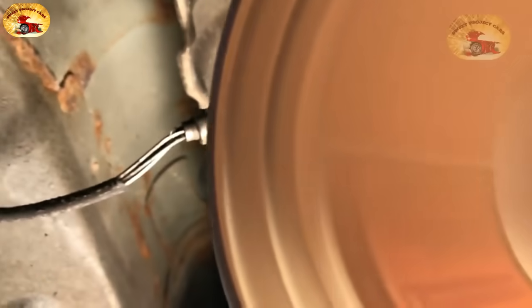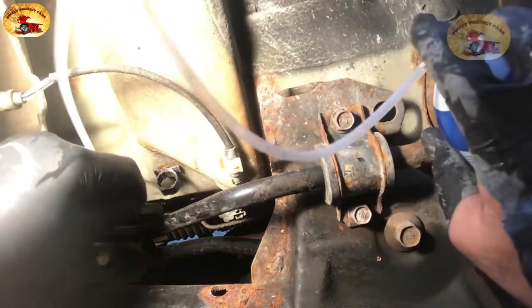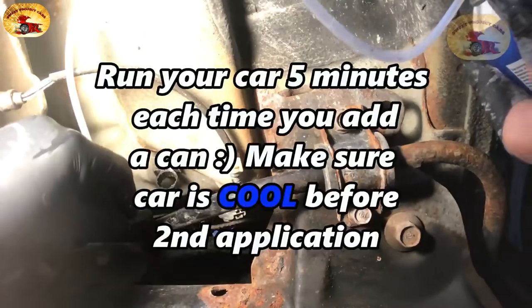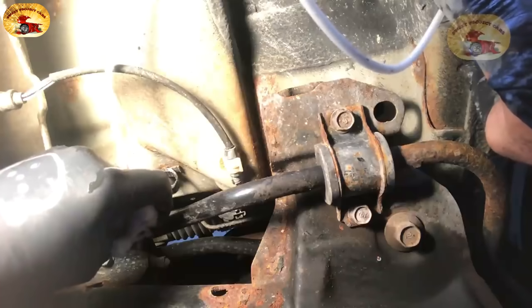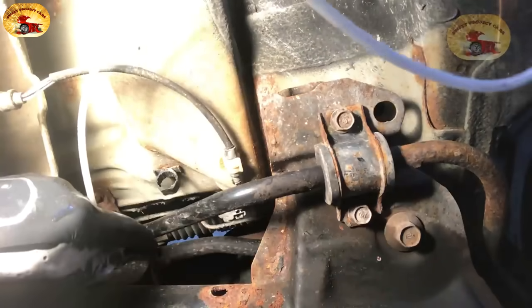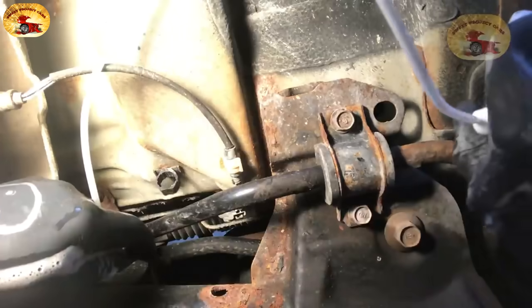Take a clean tub and drain the condensation tube into it to see what you pull out — all the dirt and everything you pumped in there. We're ready to do it a second time. Pump the larger can up in there as well, plug your thumb over the hole while holding the tube. You can see the foam building up in my hand. The single larger can is much cheaper, but you do need the hose to use it.